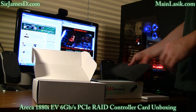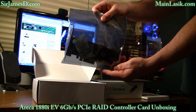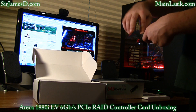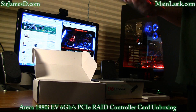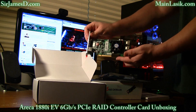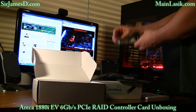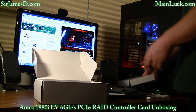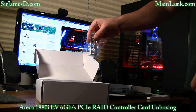You can see it's got a nice foam top for protection of the RAID card. It is PCI Express 2.0 x8, and is also compatible with PCI Express x1, x4, and x16. Onboard cache is 512 megabytes of DDR2-800. The IO processor is the ROC chip at 800 MHz. It has two SFF-8087 internal connectors, comes in a high profile bracket, and a low profile bracket is also included.